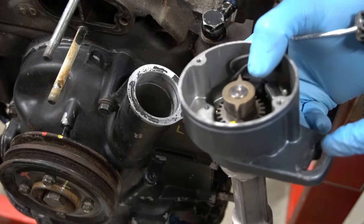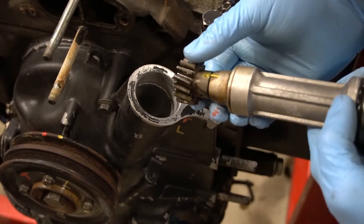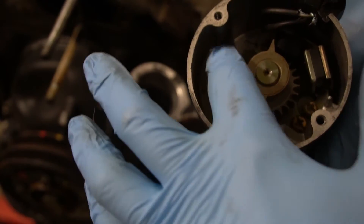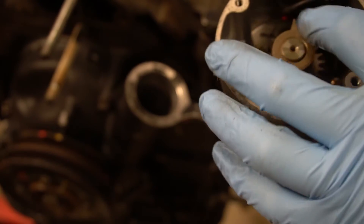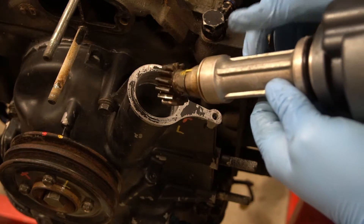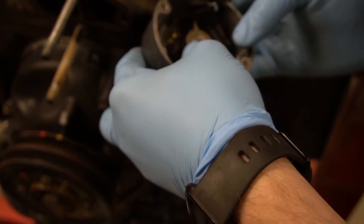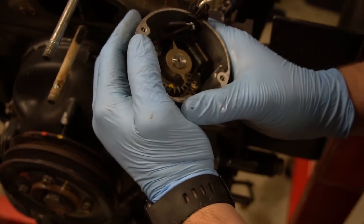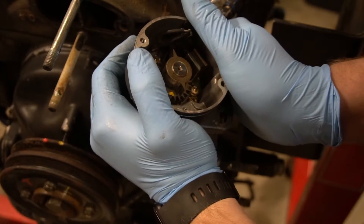The ear where your adjustment is goes down here. You're going to carefully insert this in, making sure that stays lined up — you can pull the cap off and see. There should be another pickup coil up here. That's how the engine tells which firing position it is, whether it's rotor one or rotor two. Mine does that through down here, so I've modified the wheel. Watch that and make sure this doesn't move as you fish it in there, and try to get it in the center of its adjustment. It's going to move some when it meshes with the gear — it'll move as it's riding up and down on the gear.